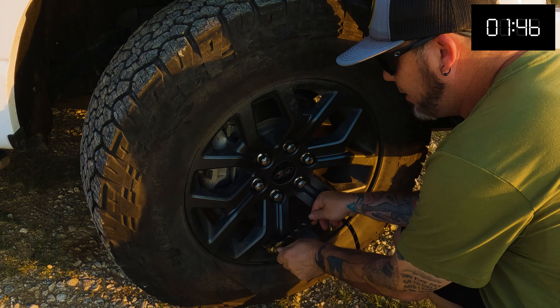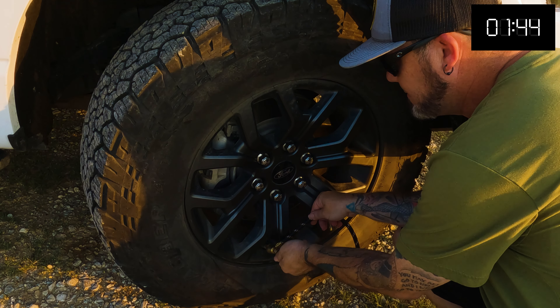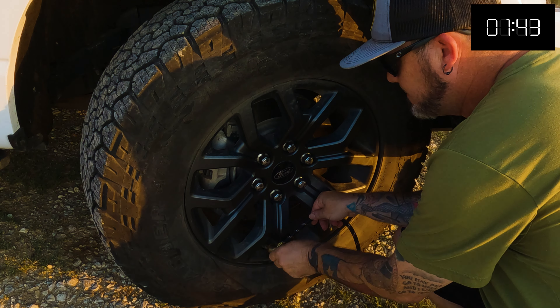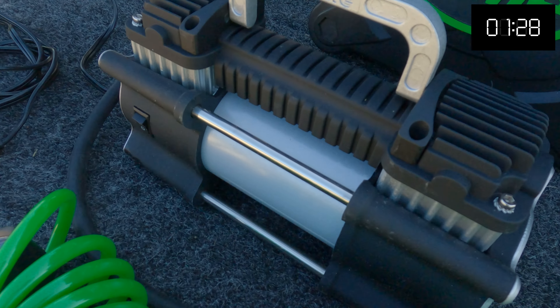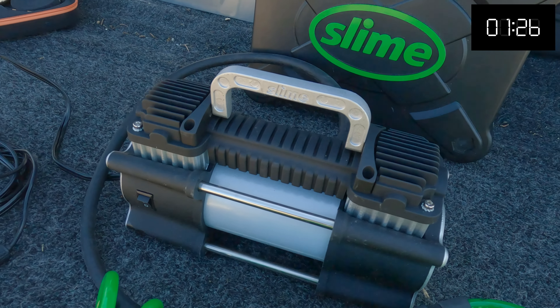This kit is pretty easy. You put it on your valve stem clockwise. Then you take your back piece, feel where it gets tight, and go counterclockwise to start airing down. You can also stop the air once you get it to your target PSI — the back piece goes clockwise and the front piece goes counterclockwise.